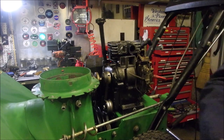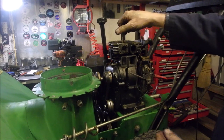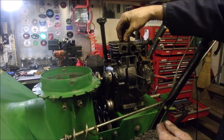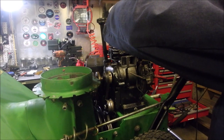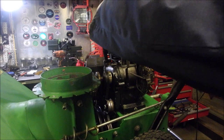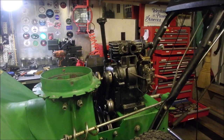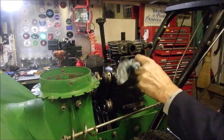I'm going to lap that right now. We've got a little problem with the valve guide which I will fix with a quarter inch drill bit. Just cleaning this valve up might make it slip in and out of there easier. I know for a fact that valve guide is a quarter of an inch and it's just a little steep — I'll get some of the carbon in there. You guys aren't going to believe this, but I'm going to take a drill bit and just rotate it. We'll wash it with a little carb spray, wipe it out, and then we're going to lap this valve.